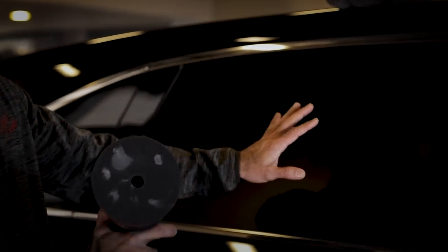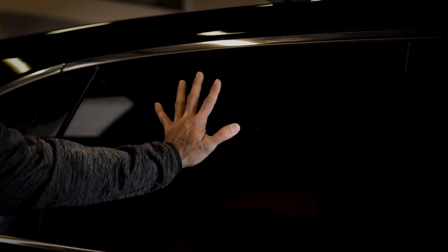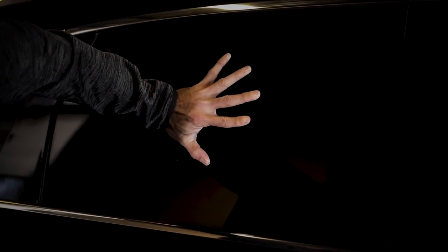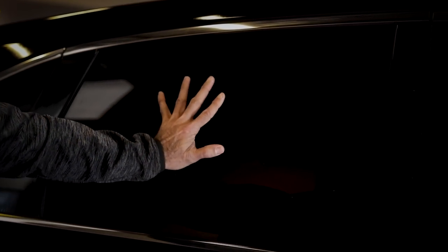Especially when it comes to finishing, what's happening is that's creating more drag, okay? When you're putting that much product on, it's creating drag. So essentially what happens is, if you say the back of my hand is the backing plate and my fingers are the foam, the foam is being dragged like my fingers are, right? So it's creating... It's not lubricating that? It's lubricating, but still, there's still drag there, right?